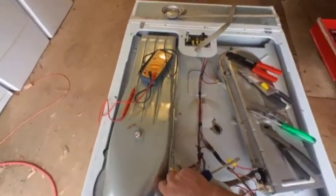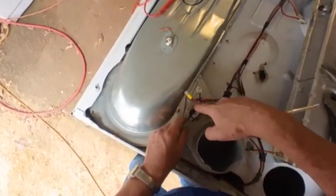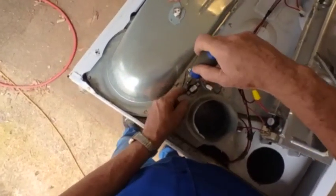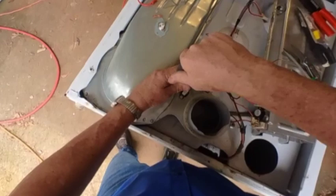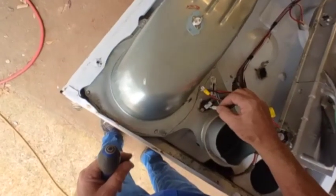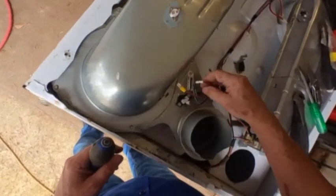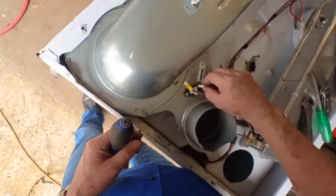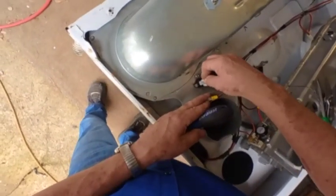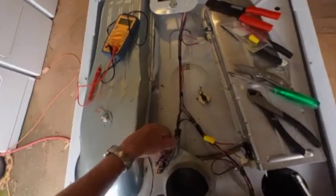Now I'm taking the old burned-up cycling thermostat out and replacing it with a new one. I use a quarter inch nut driver — most of the bolt screws in these things are quarter inch heads, with a few that are 5/16ths. I use these constantly. A lot of people use drills, but I don't like to charge batteries and they'll fail on you at the worst time. It has given me trigger finger, but that comes and goes.